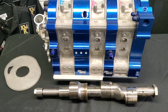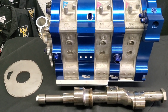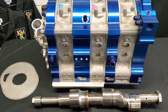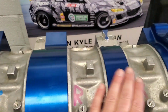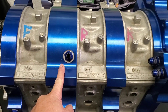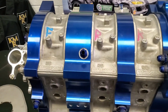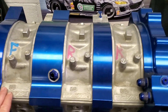We're going to pop this apart very soon. We've got a special car we're going to be putting this in, and it may even get wilder than this 20B configuration — because being billet, we could always take and remove this thick plate, sub in some more thin plate bearing carriers, change our eccentric shaft, and technically be on our way to a four-rotor.